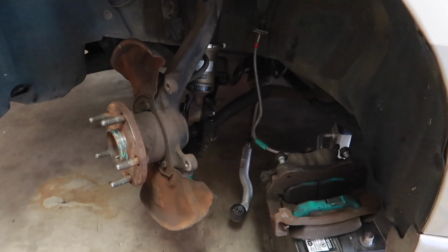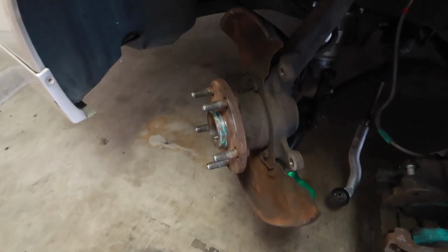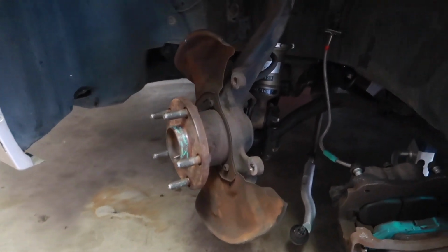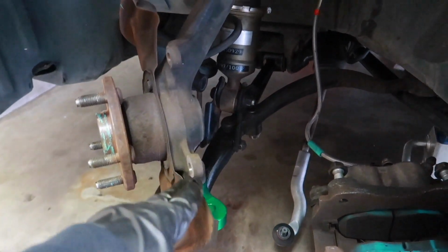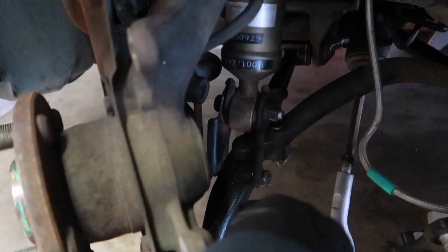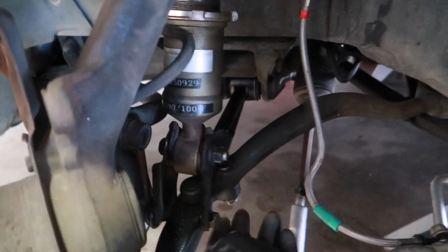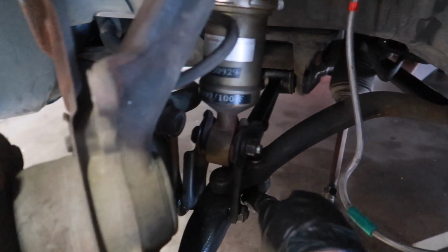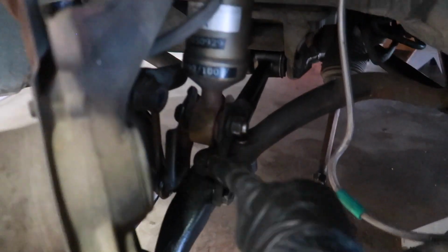Just about 90% done with the passenger side, and I can already tell how much more angle we are getting from the drift knuckle. So my advice for you when you're reinstalling everything, if you're doing this exact kit how I am, first of course install your lower control arm without the cradle, and then install your tension rods, because these have to be threaded in precisely or it's just a pain in the butt to work with. Get your tension rod bolts halfway in, then install the cradle, then the backing screw, and then your end link, and then your coilover.